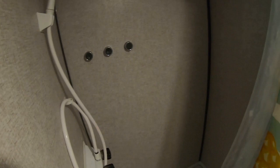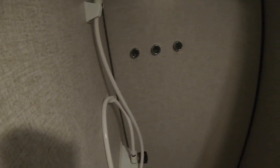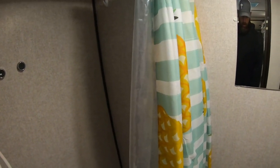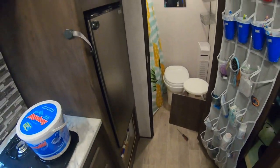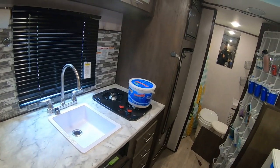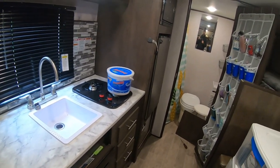I'm going to do the same thing on the shower — just turn the valves on and run whatever water's in there until it's just spitting air. There's the cold. Shut that down. Same deal on the toilet — sounds pretty clear. That's all the stuff we have on the 17B: a sink, the water heater's already drained, low point shutoffs outside I need to do, the shower, and the toilet.